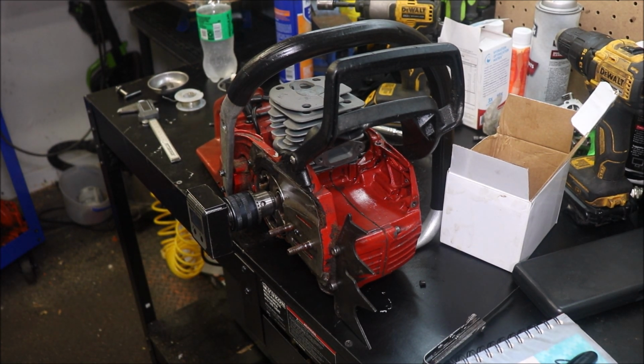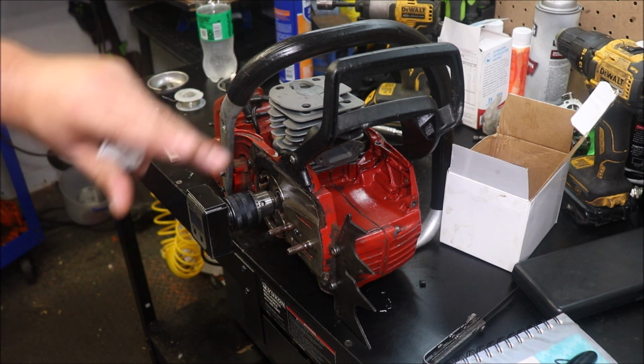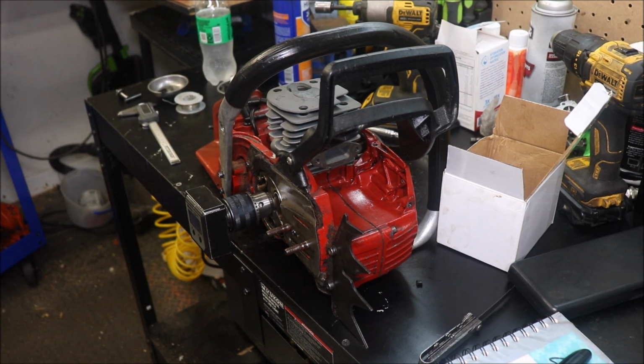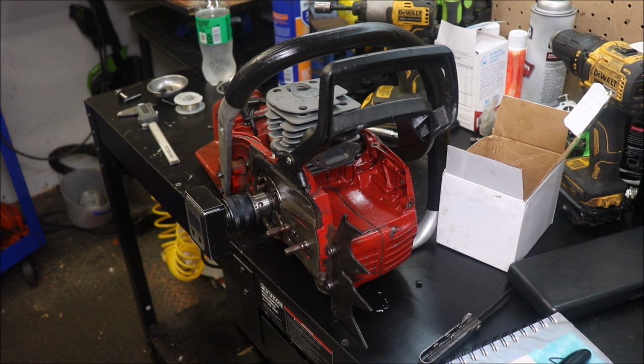The squish is a little loose, but you've got a low exhaust roof, so it's going to keep compression and torque probably right there in that stock area. So, base gasket delete and do a little cleanup work on it and bolt it on. Muffler mod, it'd be an okay running saw. Is it going to be a racer? No. But could you cut some firewood with it? Yeah.